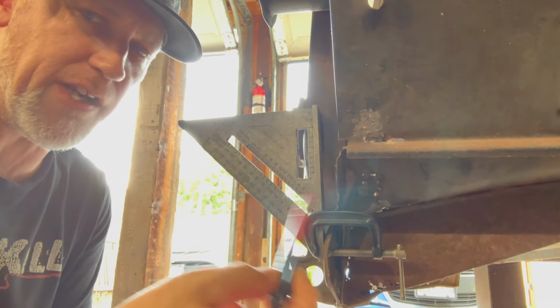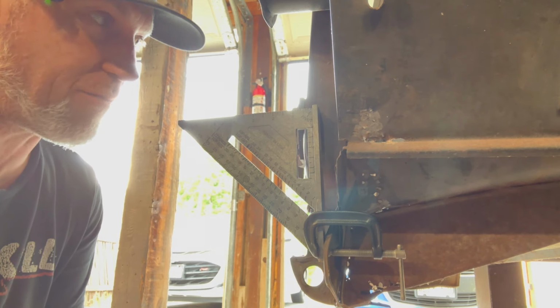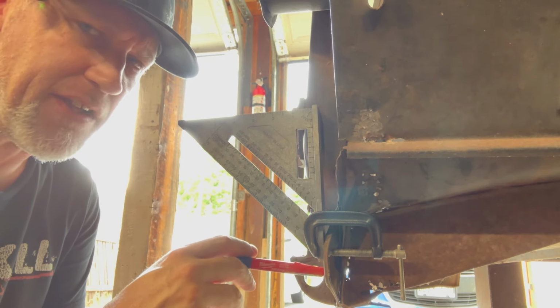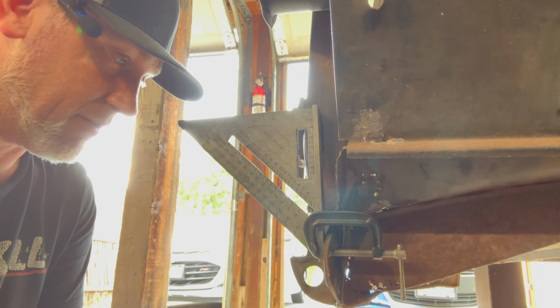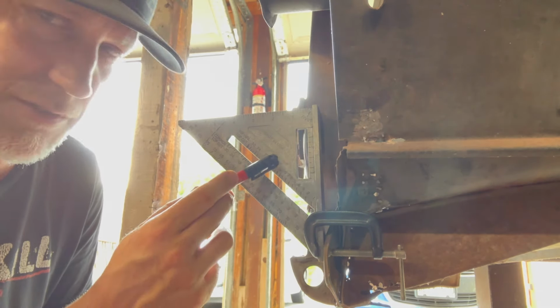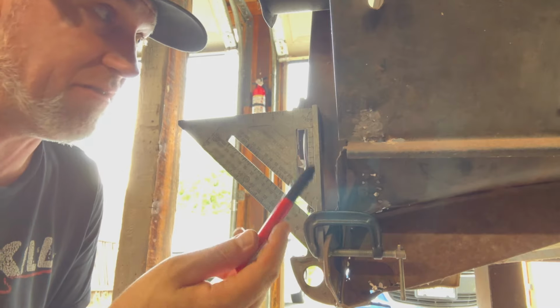Right from my lefty-righty, right here, I want the outside to be in the same spot when the new one goes on. And again, these aftermarket parts are not perfect. In fact, I have not seen a good lower pillar replacement yet. They're all pretty shoddy, not great. So they take a little bit of hitting to get them in the right spot. So I got this clamped on here, and I can't lose this tool until the job is done, because this is what I'm using. If it's straight, great. If it's not, probably isn't, because it's Harbor Freight.